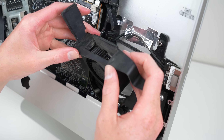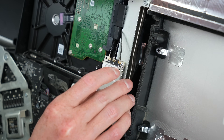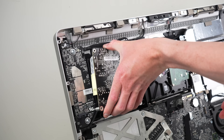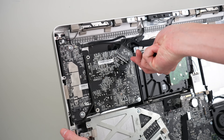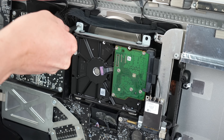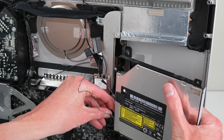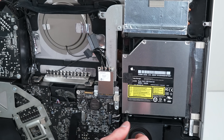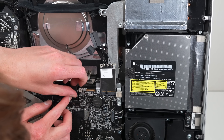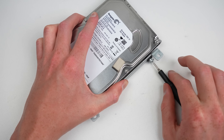It's time for the right-hand fan to be reinstalled. After attaching its flex cable, it can be positioned into place and fastened with its one screw. After the antenna wires for the WiFi card are attached, the power supply is to go in next. After its cables have been plugged in, I can reinstall the four screws. Before reinstalling the DVD drive, I'll need to remove the hard drive. This will just give us access for the temperature sensor wire to be routed through to where it needs to connect to the logic board. I won't reinstall this hard drive as we'll be upgrading it with an SSD later. After attaching the DVD drive with its four screws, its temperature sensor wire can be connected into place.